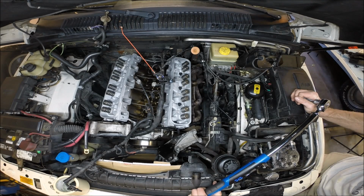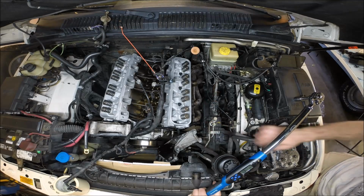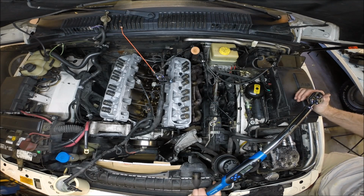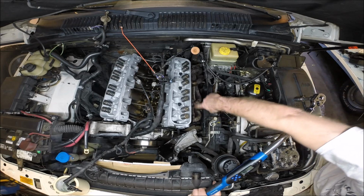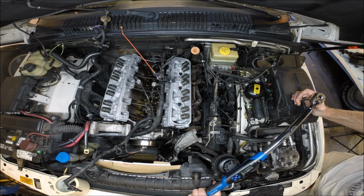But when you put things back together, like the exhaust manifold bolts, go ahead and use some copper grease or some anti-seize grease. Especially with the heat shield bolts, you'll want to use stainless. If you have some stainless bolts laying around, you can use them, or you can find some, and treat them with copper or anti-seize grease as well. And just tidy everything up as you go.